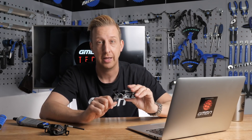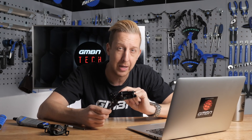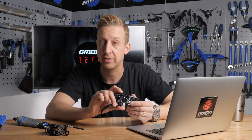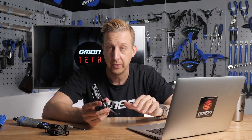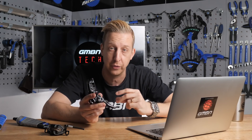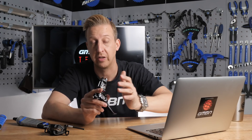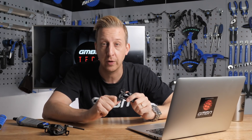All the symptoms you were talking about indicate there is air in the system, and these will go away if you bleed it properly. Bleeding brakes is a simple process, but it can be a pain with certain models, and here and there you do get brakes that are prone to it. There's also one other factor: the oil itself. On older brakes you do need to replace the oil from time to time, especially with SRAM brakes like these that use DOT oil, because DOT oil actually absorbs water - microscopic amounts can get in through the hoses and the oil deteriorates over time. Not only does it lose performance when it heats up, but it also affects the air situation inside those brakes. You should be bleeding your brakes at least annually. That said, I've got brakes on some of my bikes that I've never bled and I've just been lucky enough to keep them going - so I probably should bleed them, to be honest.